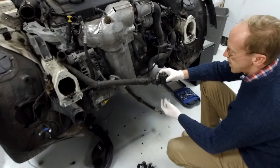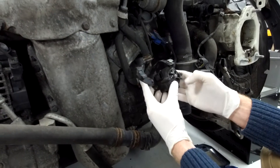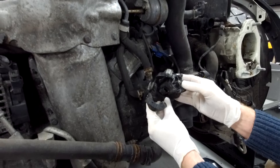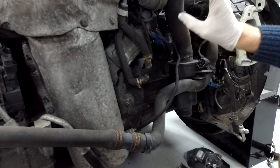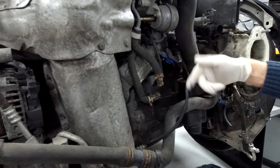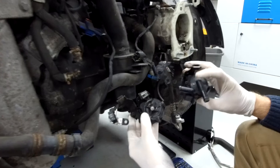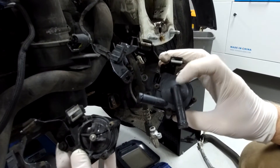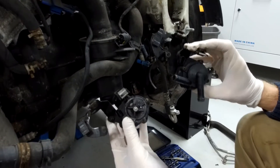We're starting to fix our Mini Cooper F project car - it had a front-end crash. This is an auxiliary water pump for cooling the turbo. We've got the turbo here and these two pipes are an in and out pipe, circulating and pumping water through to keep the turbo cool. The one on the right as you're looking at it is what it should look like - you've got little arrows showing the water flow, it's a little motor.